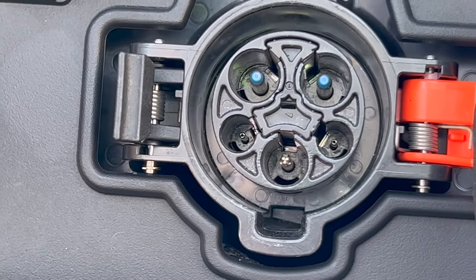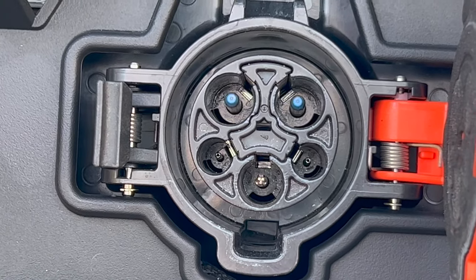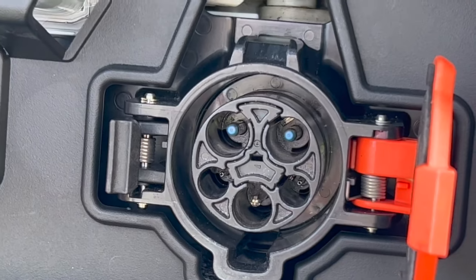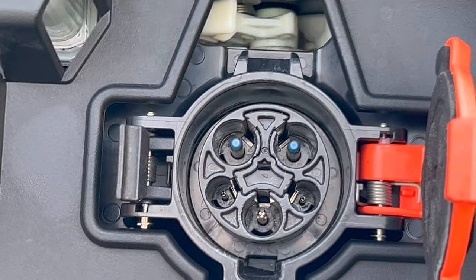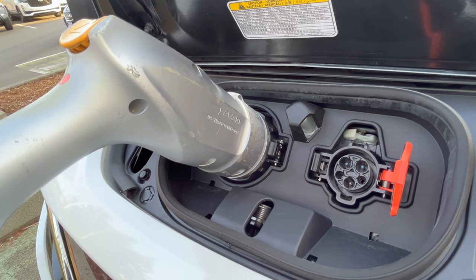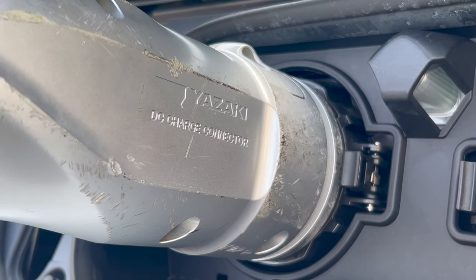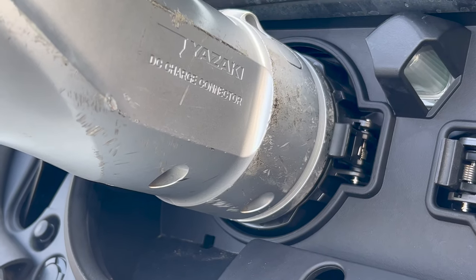These standards are so that AC at 240 volts and up to 40 amps can enter the onboard 6.6 kilowatt charger, which converts that power to DC at around 500 volts to accomplish charging the roughly 400 volt battery pack in the Nissan Leaf. Go ahead and take a close look at that connector. J1772 is pretty common on electric vehicles. And Nissan, thankfully, uses this CHAdeMO, Japanese charger design. I can't show you specifically, but Yazaki here shows this DC fast charger connector as the manufacturer. And it has a very elaborate connector that I'll show in the next video segment.